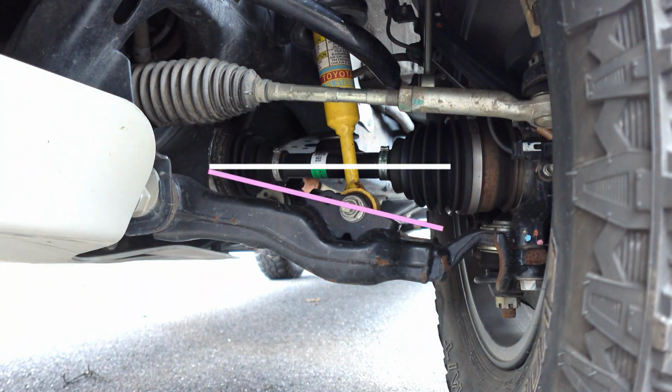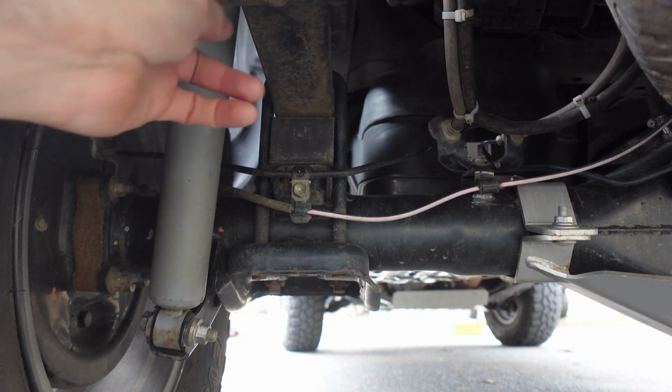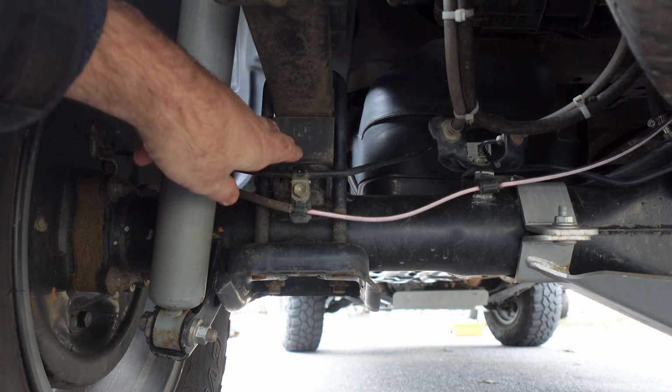So if you want to build a vehicle that gets a lot of mileage, you really can't go over 3-inch. That's the borderline. 2-inch is what I recommend. And like I said, you can get a lot of use out of a 2-inch lift kit. Now on the rear of the truck, there's two options really. You can get an extra leaf kit that'll give you a lift, or you can get a block kit.